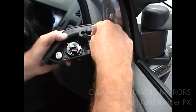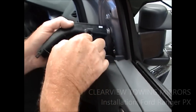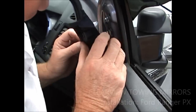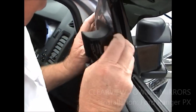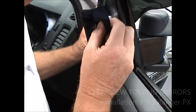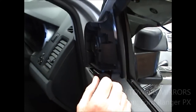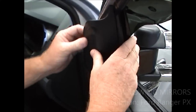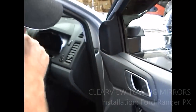Now, this loom is really as tight as it needs to be for it to fit, and there's no extra length in it, so you've got to make sure that you get this over here first, right? Once you get that in, you've got to prise the top out to get your popper clip to sit in there correctly, right? And then just push it into place. Alright, once you've got that done, put your cover back on here like that, and once again, it just pushes in, clips into place,